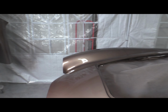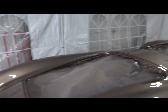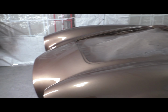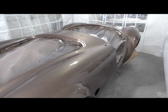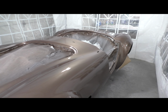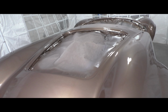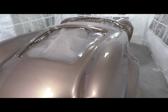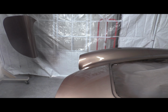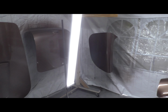I think I sprayed primer 6 days ago. So 6 straight days of work, 10-hour days. Obviously, sanding, getting this down to 600 grit, took probably 20 hours of sanding, maybe more, considering I had my buddy help me. So go into it expecting that much. I've got a drip here and maybe a sag in another spot in the clear that I've got to work on, but those are easy fixes.